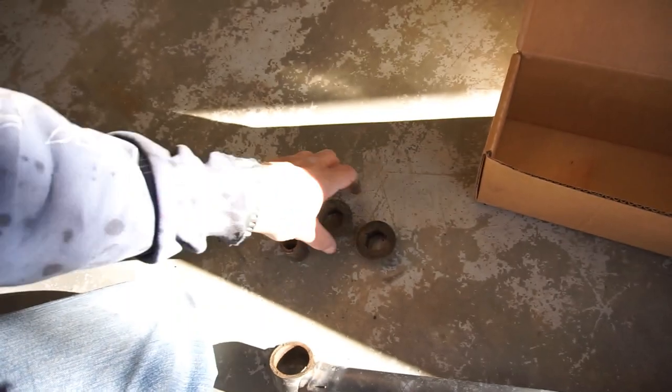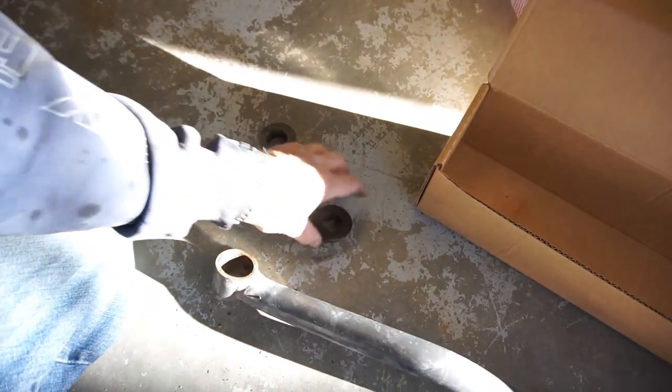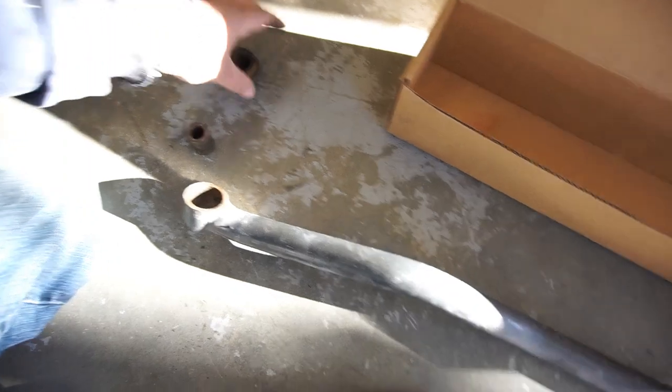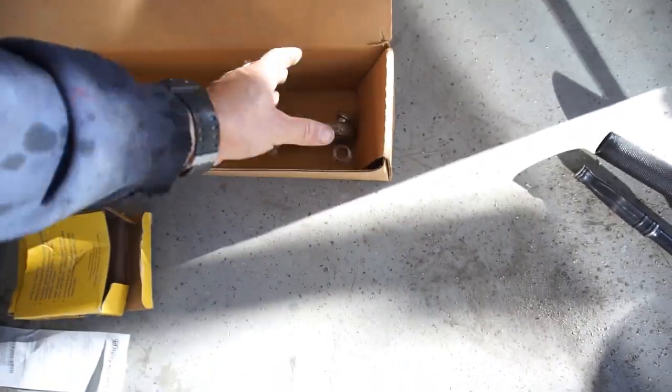They'll add thick ones. I was looking at the BD track bar. The BD track bar's got big old huge, I mean, it's massive, like that thick. Like another inch thicker than this. But they still have polyurethane bushings. So you can have as thick an arm as you want, but if you got these stupid bushings, these bushings are going to blow out. Just make them with Heim joints. I mean, a good Heim joint. I'm sure that's eBay. So anyway, guys, that's going to be it.